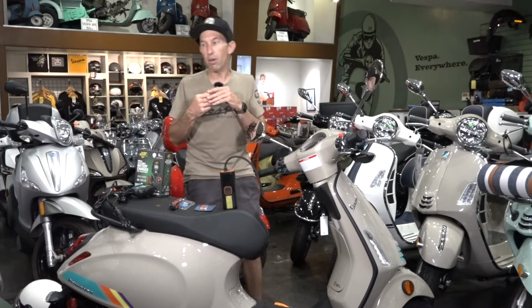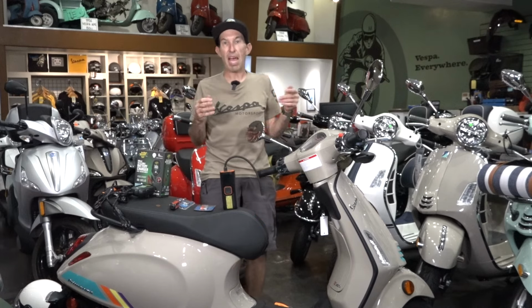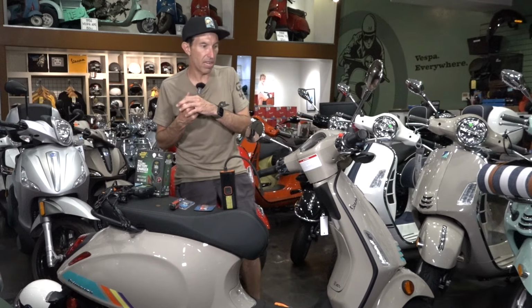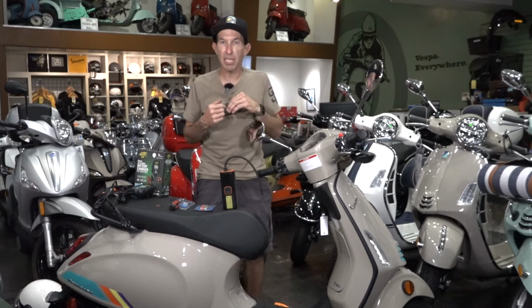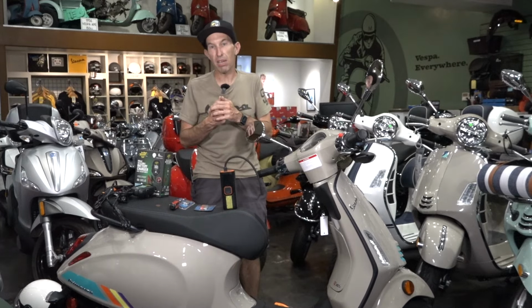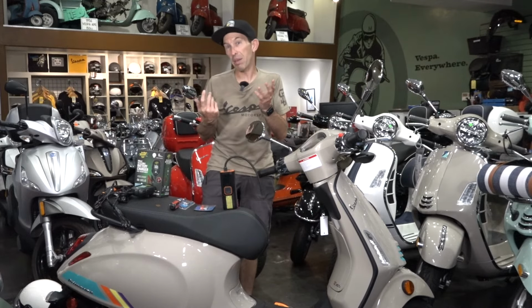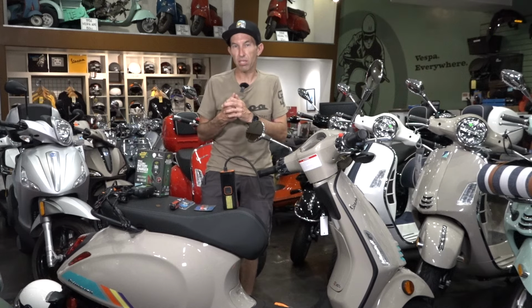So I'm not going to go into every single part of it because I have several videos in the past that talk about doing all those services if it's something you want to tackle yourself and not take to a dealer. The nice thing about the newer models, they do have a little wrench that comes on, a mileage-based indicator. And once you get past the first service, services on this model are every 6,250 miles, or 10,000 kilometers is what that translates to. I do recommend an oil change in between, and I would definitely recommend just servicing it,